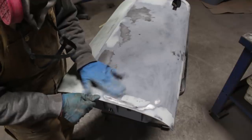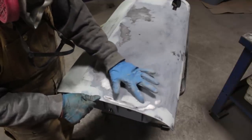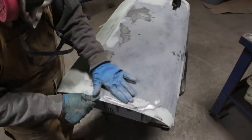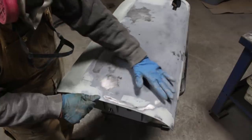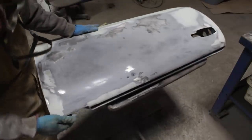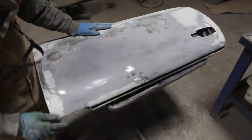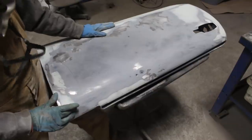the area next to the bare metal, I guess this area is low. And I applied some body filler here before, but I didn't have enough, so it wasn't enough. So now we're gonna put a little bit more here, but other than that, here we are fine. This needs to be feathered. This sharp line is gonna disappear.